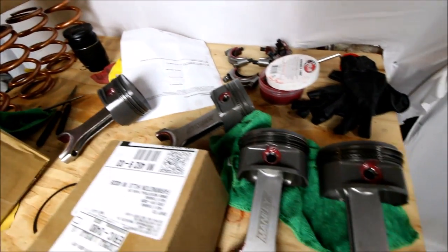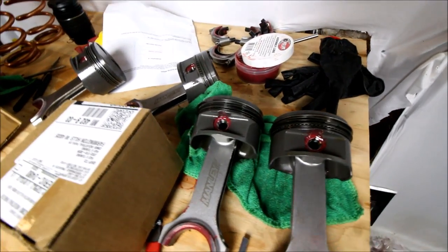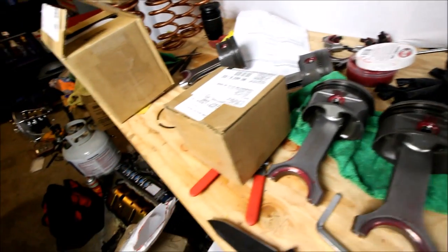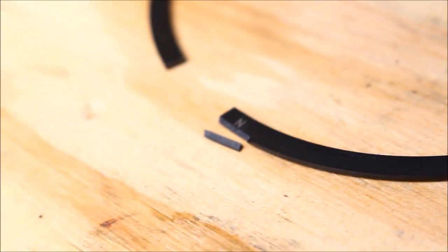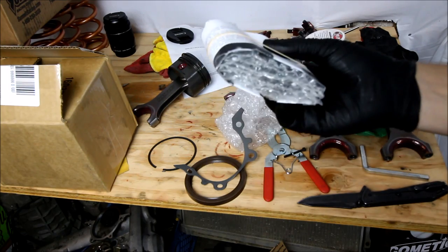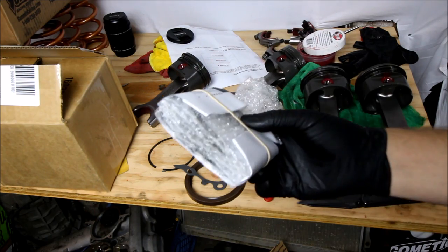I've regrouped, I've ended my frustration. I did this right before I was leaving for vacation, so I didn't even touch the motor after that. I pulled all the pistons back out of the engine to inspect every single ring, even though some of them went in smoothly. I still wanted to check them out because I feared I had damaged other ones, but it was actually just this one right here — there's the little bugger. Just a tiny chip off the end of that ring right there.